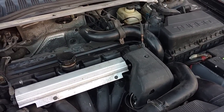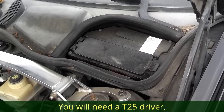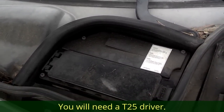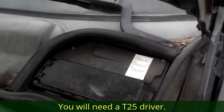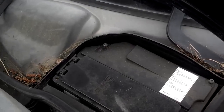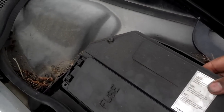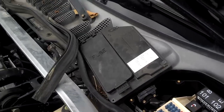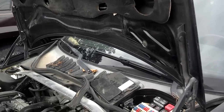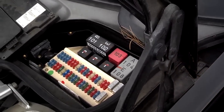Don't confuse the fuel pump hum with your idle air control valve hum that you hear up under the hood. The fuel pump relay is under the fuse panel, so you need to take out the four screws on the corners of the fuse panel and get that cover off. You can start by taking off that trim. It's a little easier to get the back screw with the hood all the way up at a 90 degree angle — you just move the levers on either side to get it like that.